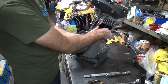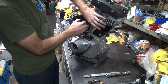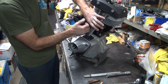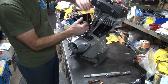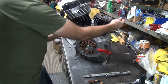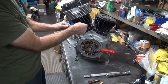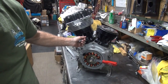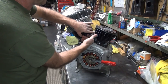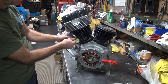There's a lot of movement on that thing. I want that up until I just touch it, but I did not torque it. So those two are torqued over there, then I go to the next one, which is in the middle on this side — it pulls the head down evenly. Otherwise you're going to cock the head a little bit if you go around the other way.